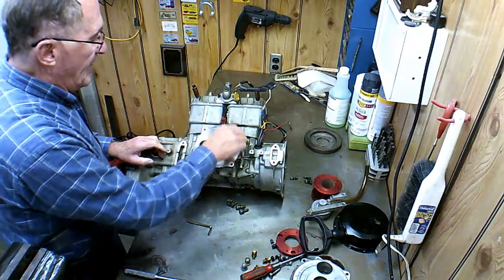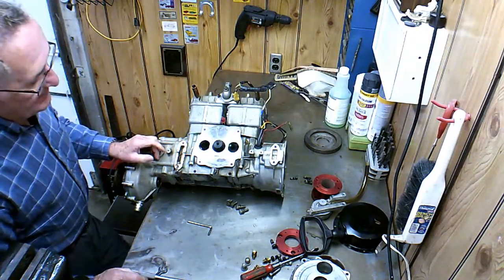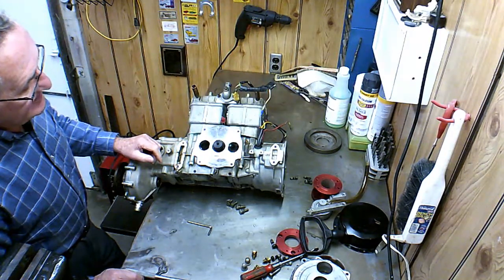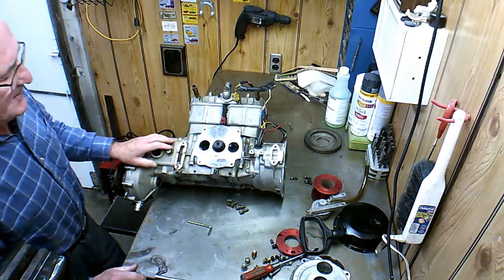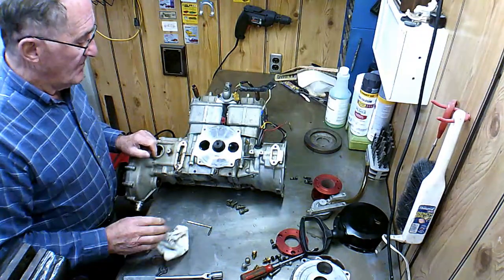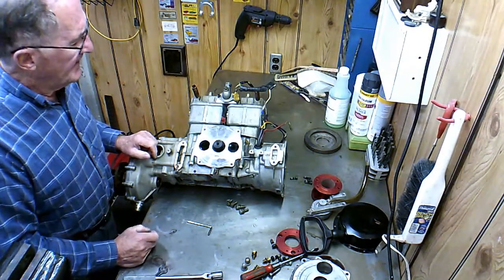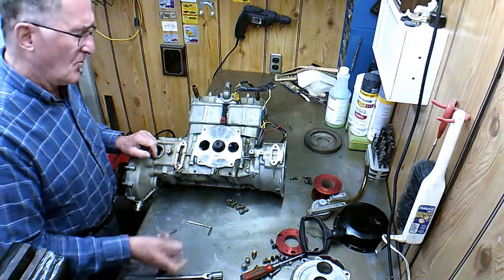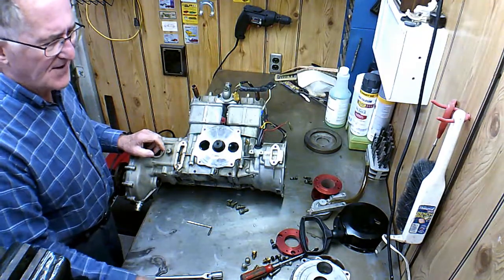So the way we found this out is the fellow that owned this engine that gave it to me, we both flew together up to Put-in Bay on a flight, and we were comparing how much fuel we used and so forth. We're flying side by side, and I see him putting some oil in the tank on this thing, and at that time this engine was mounted on a Quicksilver, and I asked him, just exactly how much oil did you use on this trip? And he says, oh, I got it marked. He was real careful with his calibrations and everything, and he told me the amount of oil he used, and I said, well, I put in 6 gallons of gas here, and that's one pint of oil. You aren't using near the oil that I am, not even close, and I got a little 447 engine.